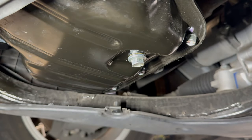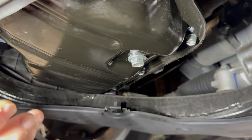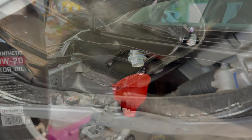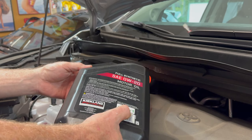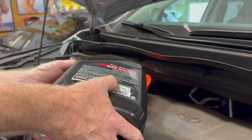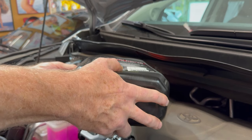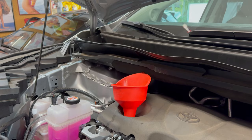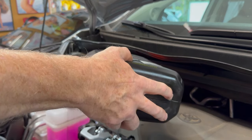I won't put the tray on yet — I always start the car and check for leaks, even though I don't generally ever get them, but it's a good habit. I always shake up the jug of oil before I pour. Like I said, this takes 4.8 quarts, so just about the full thing. I usually leave just a little bit and always have an extra jug with the excess.